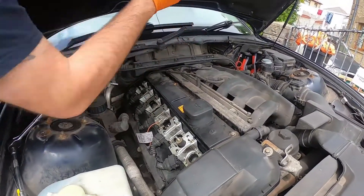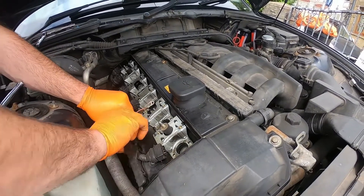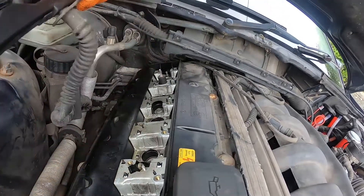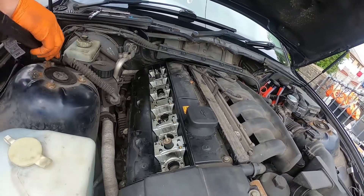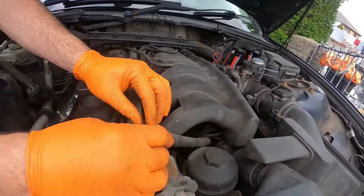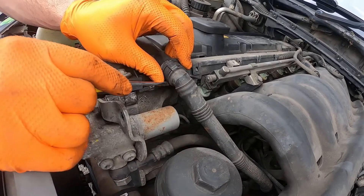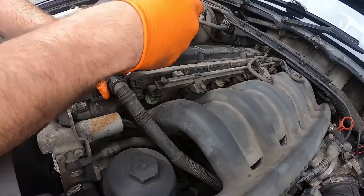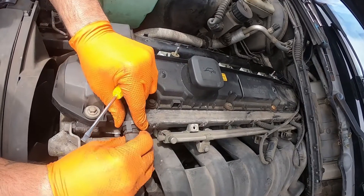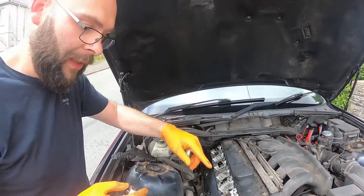With all the earth points free, this piece of wiring can now be pulled away — you can usually just pull it off and lean it forward, but go carefully and don't break anything. Then this whole wiring piece can be moved up and out of the way. The next part is this pipe — I would say you have to be very careful with it because with time these become very brittle, as I found out on the 5 Series before. Best bet is just to really take your time with this one. You just squeeze these two together and that's usually enough. And there we are — this is now completely detached from everything else.